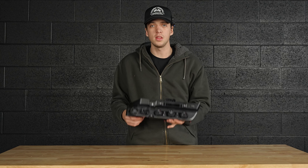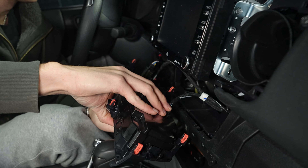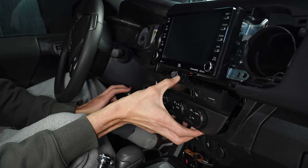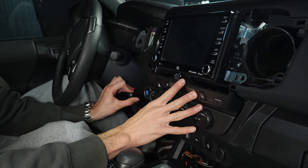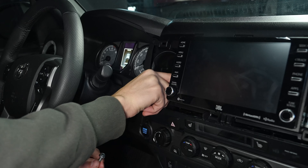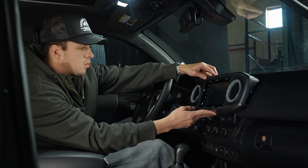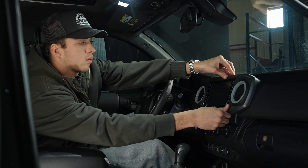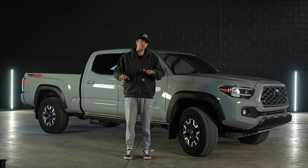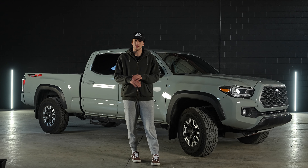Now that that's back in place, hop in the car and get this rewired back up. Replace the wires and the panel, and since the radio was loose, the clip will just be able to clip right back into where it was. Push down on the bottom, replace all of your screws, and place the dash piece back over here, line it up, and it just clicks right back into place. And just like that, all of the chrome has been completely deleted from the inside of your truck — it makes it a brand new truck. I love the way that this truck turned out with the pieces that we were able to use. Be sure to look them up on our website — the AJT design stuff is amazing. Thanks for watching.